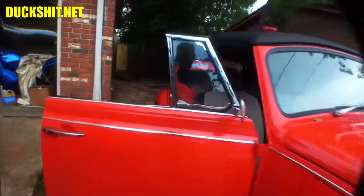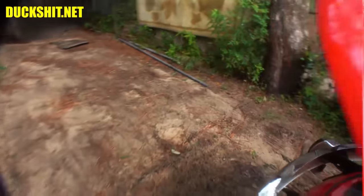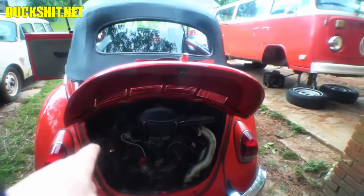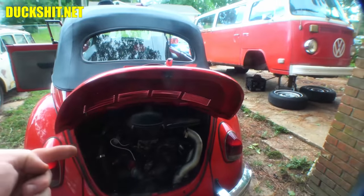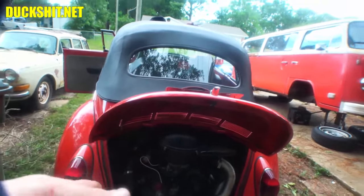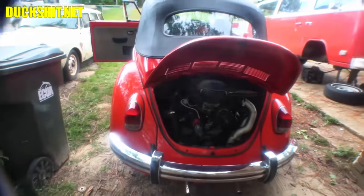I'm going to leave the pedal cluster alone for the time being. We'll handle that later. But I do need to fix where the fuel filter lives. So what I think I'll do is pull the fuel filter out, as well as the little stub that's connected to it, run the fuel line directly into the pump, and taking the stub and the fuel line, reversing the line to the opposite side, plug it in underneath the car instead. Done. Shouldn't take too long.